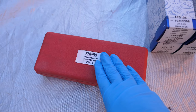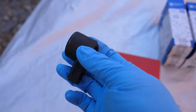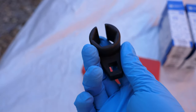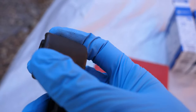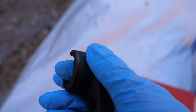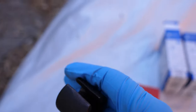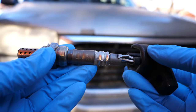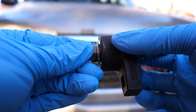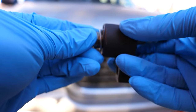I rented this tool from AutoZone — it's an oxygen sensor socket wrench. It comes with multiple sockets. This is the one I'm going to use: a 22 millimeter short oxygen sensor wrench. The reason I'm using this one is because it's a very tight fit and this is what's going to give me the clearance I need to take out the oxygen sensors. You need a special socket to slip it through the cable so you can get to the nut, and then you can put any three-eighths inch wrench on it and twist it off.